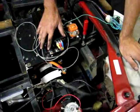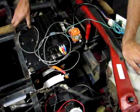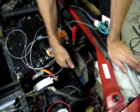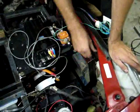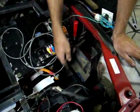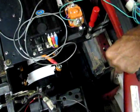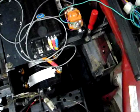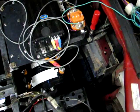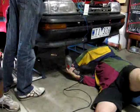Alright, so this is the front of the battery rack with our controller plate. We've got a DC-to-DC converter to mount on here. At the moment we had an end that was a bit wobbly, even though it's mounted elsewhere, so we're putting in a vertical here down to a plate just near the stabiliser bar. Just doing some tack welds getting it all in place, and tomorrow we'll clean it up, add in a few bits, more tack welds, then take it all out and clean it up and paint it.